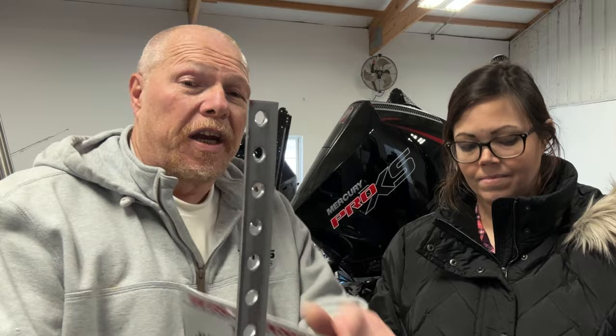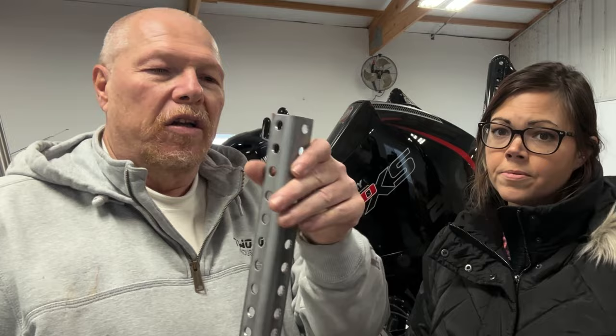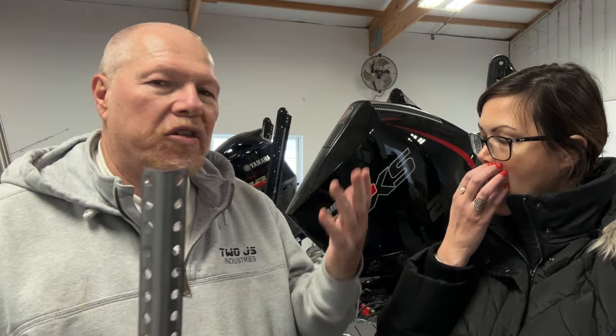So what I did is I went to the hardware store and got a piece of angle iron that has holes in it. Now I'm going to take that angle iron, line it up to my holes, and cut it so that I've got one piece on the back on this side and one on the other side. Then I mount my license plate with that angle iron behind it. That will make it sturdy so that it will not bend. So you're not moving it or putting it in a different location. You're just adding something to make it stronger. All I'm doing is adding this angle, and with that angle there, it won't bend at all. That's just a principle of fabrication. You put that on there and it'll stay sturdy the whole time.